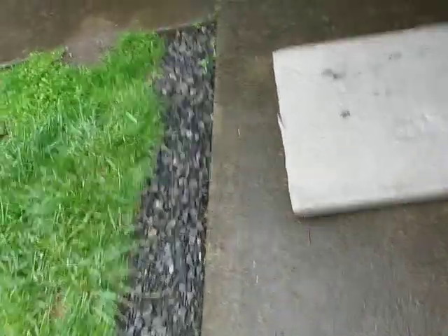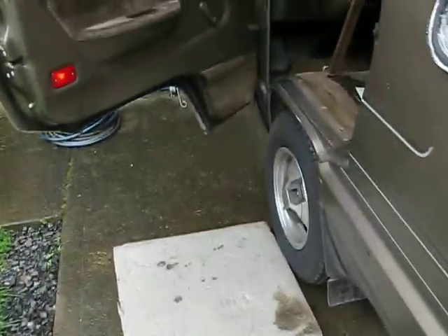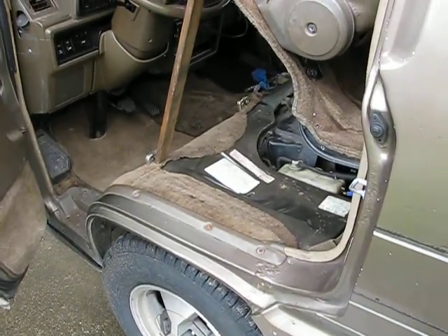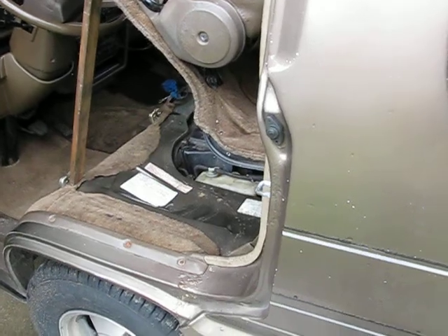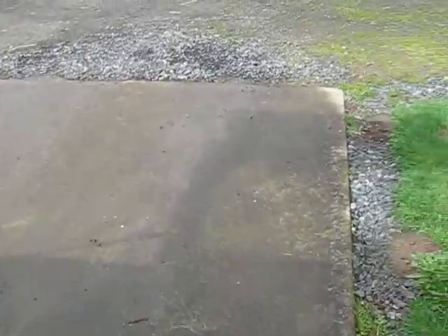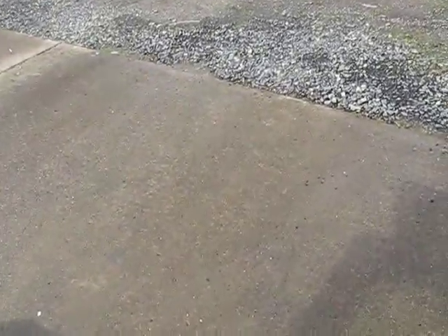The fan itself is riveted shut, so I didn't really want to open up the silicone part of it. But what I ended up doing is cutting a new groove, as you can see in the pictures, because if I went to the first groove above in the casting, it was way too much — the clutch fan would never disengage. So I cut a new groove, as you can see in the pictures, reinstalled it, and I nailed it.